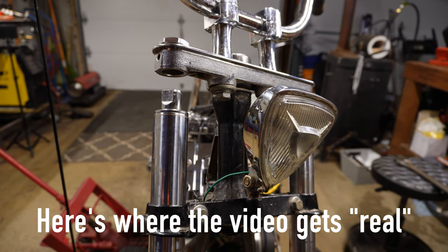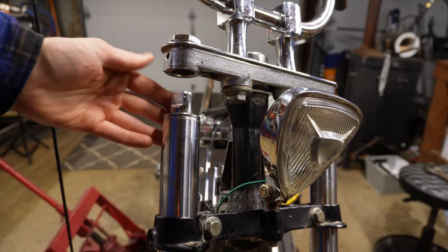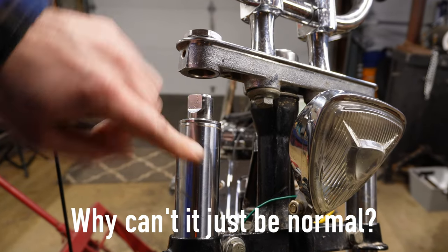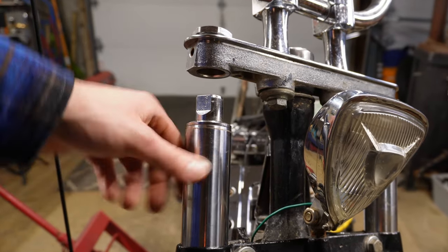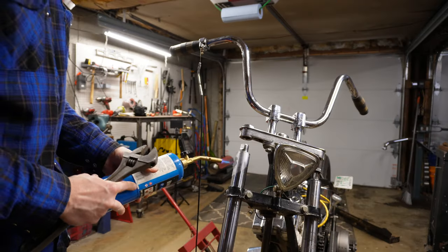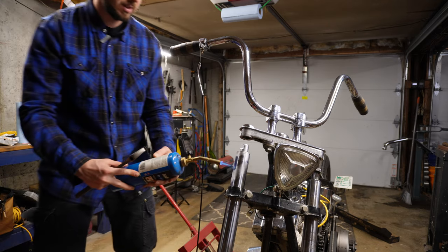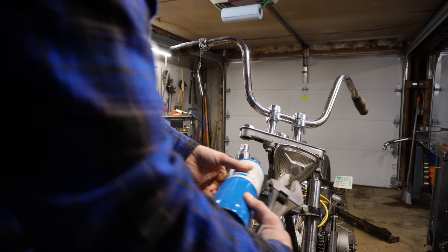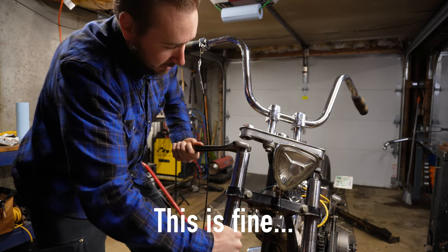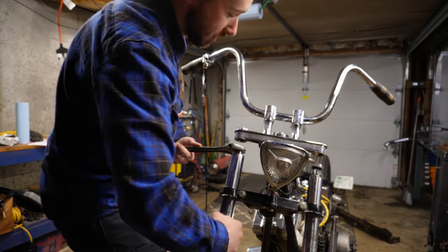I want to be honest with you about the whole installation. What I'm running into is that cracking this nut here — the one threaded into the fork tube itself — on one side, no problems, came right out. But this side, I am struggling to get it off. So we're going to get a little bit of heat on it to see if that helps it break loose. The whole fork is still spinning, so it needs a little more heat. I'm going to try to hold the leg to give some additional resistance.